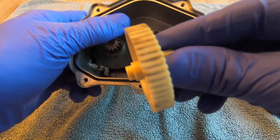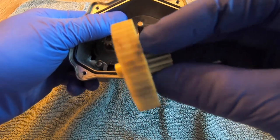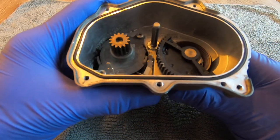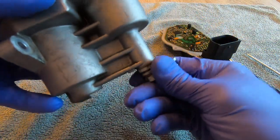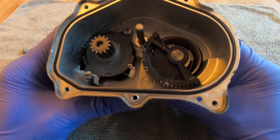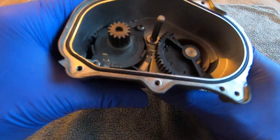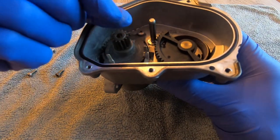You can even see the worn gear grindings inside the teeth from the black gear. So although overall the whole throttle actuator doesn't look in bad shape, this plastic gear is certainly deteriorated — definitely ready for a rebuild. It certainly wants a good clean out to get rid of all these plastic grindings, which are certainly not going to help things getting through all the mechanism.